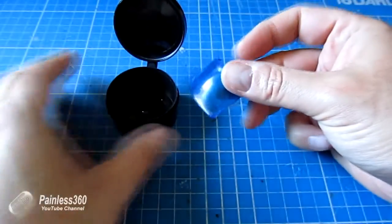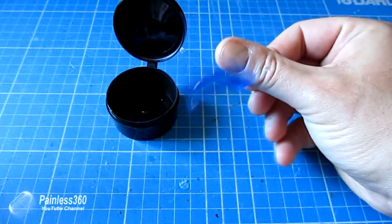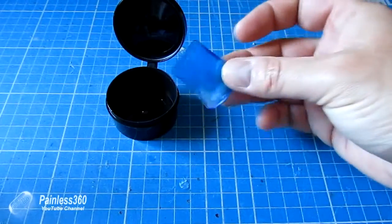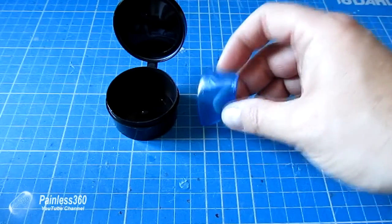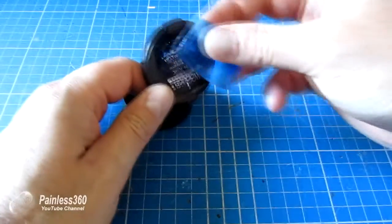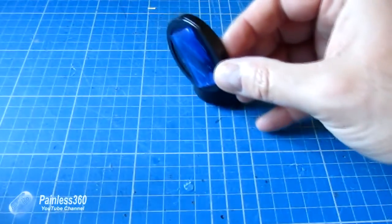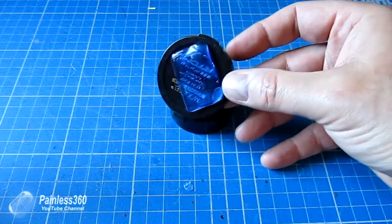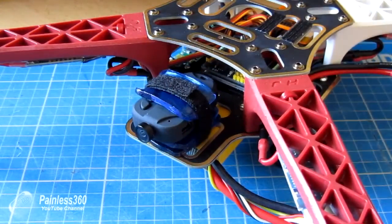Balancing the motors with the rotors on, typically the way I do that is run each arm in turn with the rotor attached, being very careful, and then put a small cable tie on the outside of the motor and keep moving it round until the arm that I've got my fingers against feels the least amount of vibration, and then work my way around the craft to do that, making sure that all your mounts are done properly, that you have nothing that's vibrating against the chassis, and that where possible, if you need to, you're using rubber washers as well.